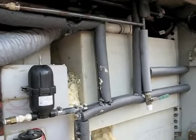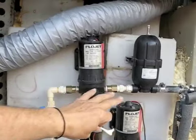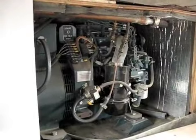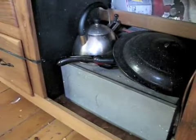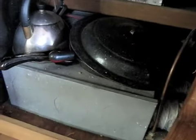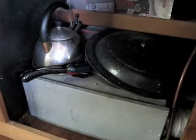It just doesn't transmit enough heat, but you make a little hole here in the winter and let heat out on your water manifolds so your pipes don't freeze — that part I like. This is our 8-kilowatt Kubota diesel; no problems with it, but I would make it so it could roll out — that's a sure thing I would do. This is where our furnace is — a 35,000 BTU unit. The air intake is there and this pulls a lot of air. It runs a couple of vents each way, but we don't have doors on it because it just restricts airflow too much. I would put one furnace of 15,000 to 20,000 BTU in front and one in the back in the sleeping area, because the heat just doesn't get back there otherwise — I think it's a better design.